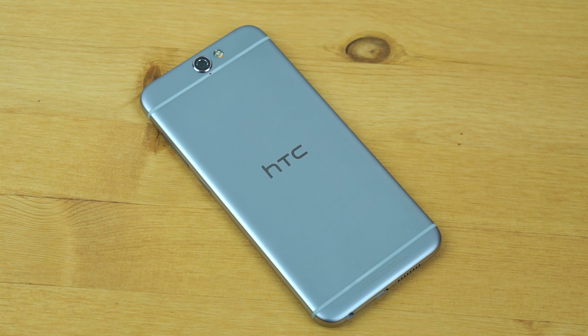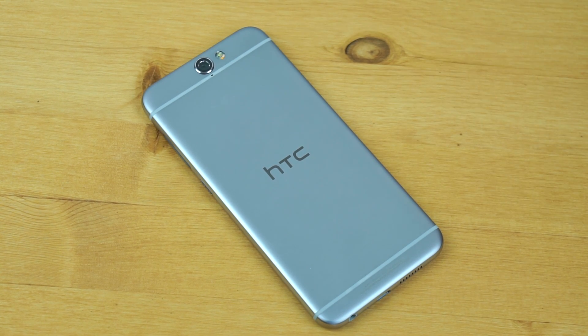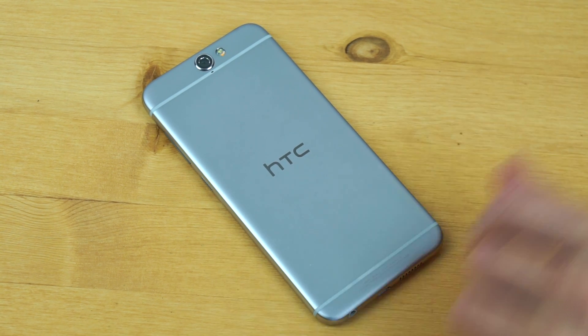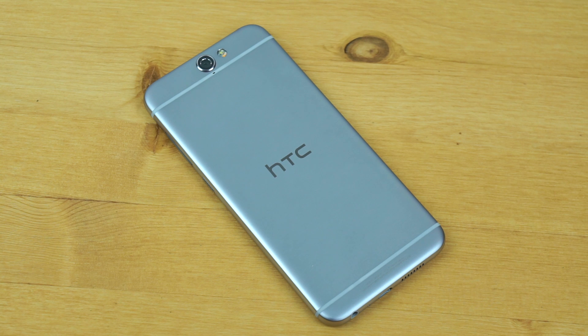If this is a so-called mid-range phone, why is it called mid-range? It runs on the Snapdragon 600 series — the 400s are for lower-end phones, the 600s are mid-tier, and the 800 series is in all flagship phones. This is the Snapdragon 617, an updated version of the 615. It's an octa-core CPU with four high-power cores at 1.5 GHz and four low-power cores, with Adreno 405 graphics.